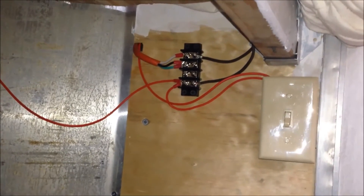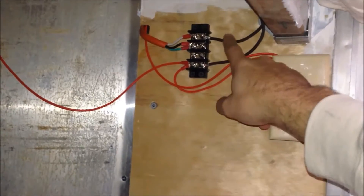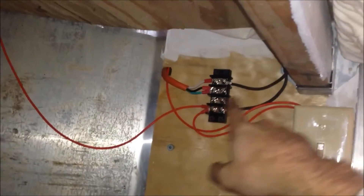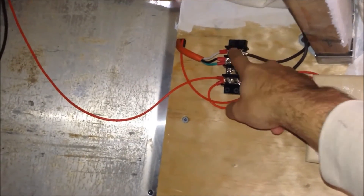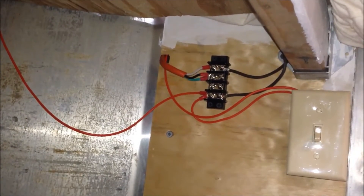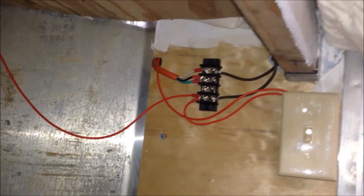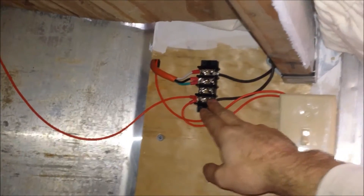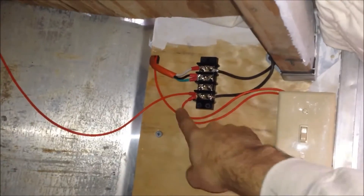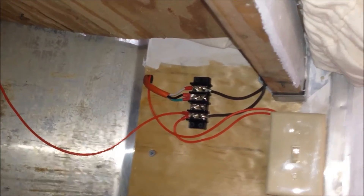This is my switch for the outside porch light. I've only got two runs coming over right now — one fuse feeds the porch light as well as my water pump, and the other line feeds just one single run for some future wiring in the back tool shed area of the trailer. Right now there's nothing actually connected to that — it's all pre-wired. I just wanted to give you a view of these junction boxes and how much they can come in handy. In the future I'm going to upgrade the wiring and get each one individually wired up.